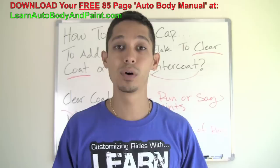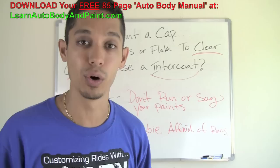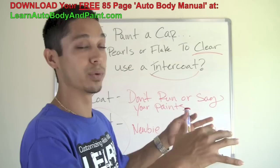I thank you, and I hope you enjoyed this short little video and learned about intercoats and using a DBC DBU mid-coat intercoat to mix your pearls in and spray your car. So basically, you're making a tri-coat out of this whole thing now. You're doing your base coat on your car. Say you have a white base coat and you want to put a red pearl on it, so you mix your red pearl inside of your DBC, DBU. Spray your whole car, it's going to look flat with the pearl on it. Mix up your clear coat, put it on, you're done.